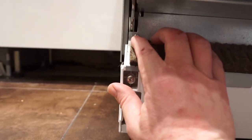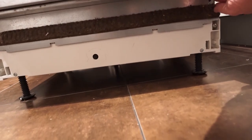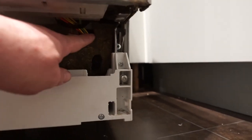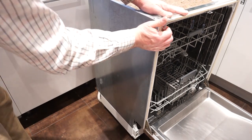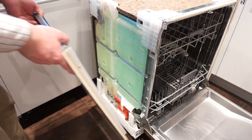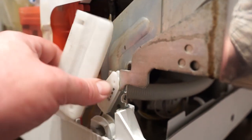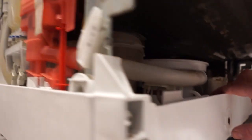On this front panel we have two little screws either side that need to come out, just behind the sound deadening. This lower panel can then be removed, and also the sound deadening behind — just note there's a little cutout for the cables to come through; this lifts out from the slot at the bottom. On the left side as I face the machine there are two screws, one at the top and one at the bottom, that need to come out next. With those done we can remove the side panel — it pops off at the top first then lifts out from the slot at the bottom. Down here is the part we're interested in: it runs from the top of the drain area around to a pressure chamber on the side, and it's called the balance hose.